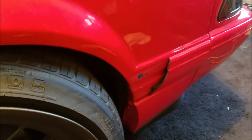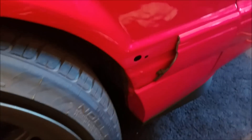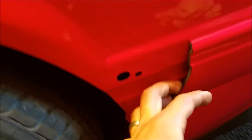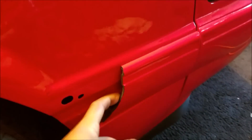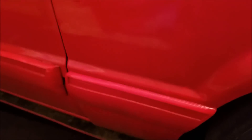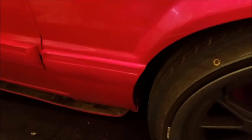The first thing you want to do is get these side moldings out of the way. A lot of people cut their fender flares around the side moldings, but it's actually going to give you a better fit to cut the side moldings. I tried to remove this one and it broke in half, so you really want to be careful. The previous one I removed was made out of a flexible plastic rubbery material, so I wasn't expecting this one to snap in half. I may just peel this one partially back, but this molding will not be going underneath the fender flare — we're just going to cut it short and contour it to the fender flare.